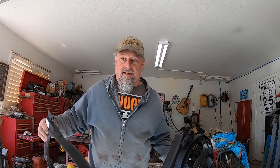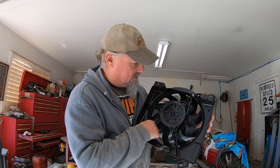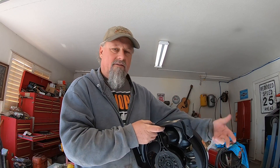There's a reason why this is on your vehicle. The shroud is integral to this piece — it needs to be here for the fan to work effectively to draw air through the radiator. Otherwise it would be drawing air from inside the engine compartment and not drawing enough air through the radiator to keep the car cool.